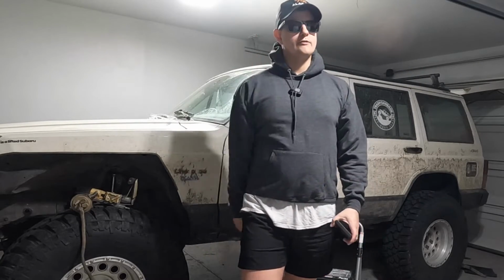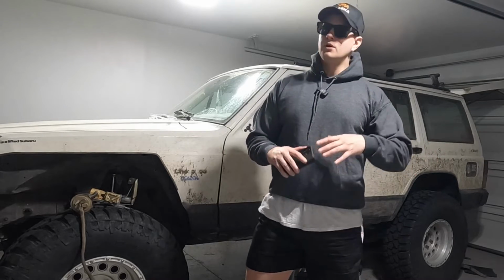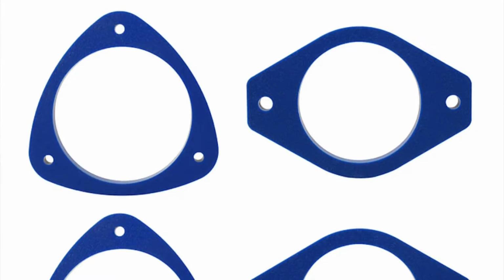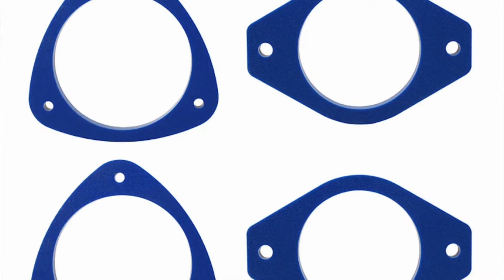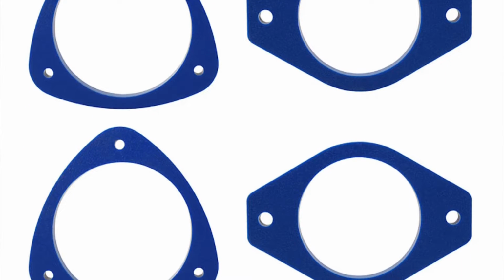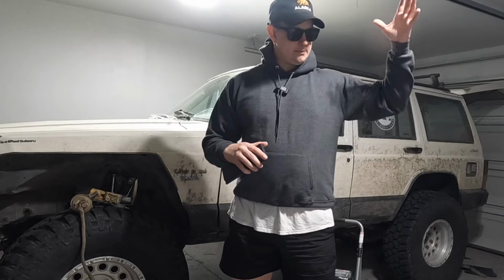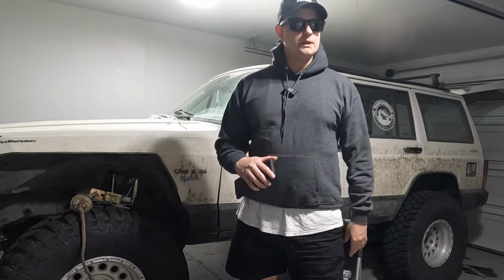So number one, the first category of lift kit sizes that you're going to be looking at when it comes to lifting your Subaru is going to be just real small, basic 1/2 inch to 1 inch spacers. Now, these are typically real simple. They typically don't include any kind of geometry correction in them for the alignment. There's usually nothing complicated about them at all. You typically just slide them right over your stock strut assembly. You just put them over the strut top, boom, put it up, and it's good to go.